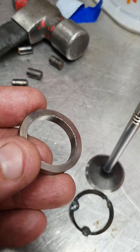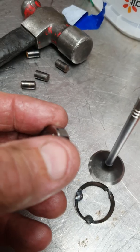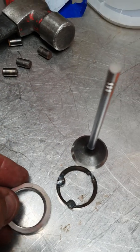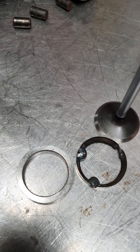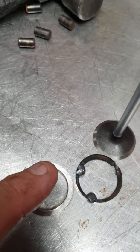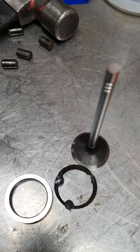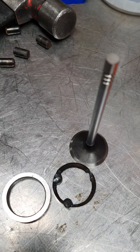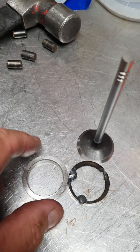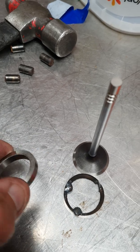What I do is get some real high-nickel inserts made up by Bundy in Queensland. These are special inserts made up for us — they put a nice radius on the bottom so they fit up nicely. I'll fit them at seven-eight thou interference, so you'll see the difference in the size of the insert. I'll use this insert on a standard valve and also on a larger valve, so we can take the valve throat diameter out to what it needs to be for proper flow. That gives a 25 to 30 percent increase in airflow just from the valve seats, with a very minor blend into the bowl.